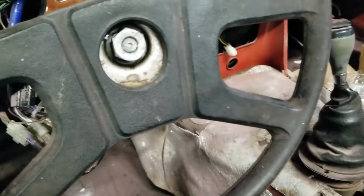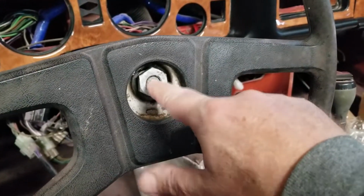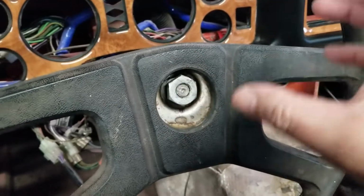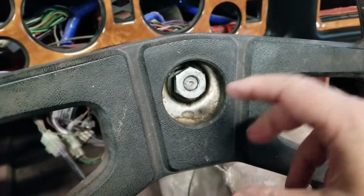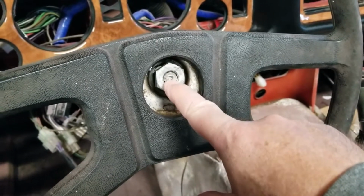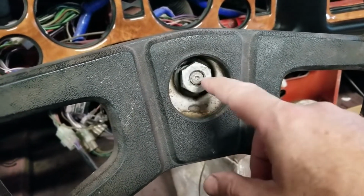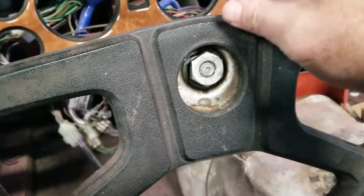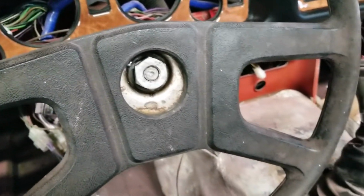Basically, you take an air hammer and you jack it in the middle, and instead of just hitting one or two times as hard as you can, you're hitting hundreds of times within a few seconds, and it really breaks free the rust from the splines and the shaft behind the splines.